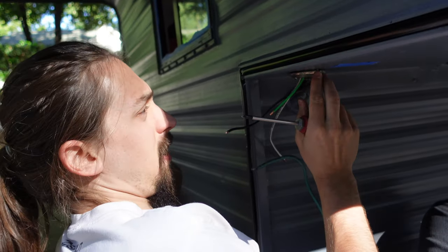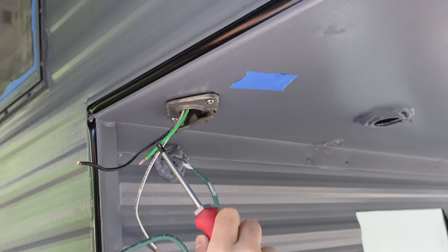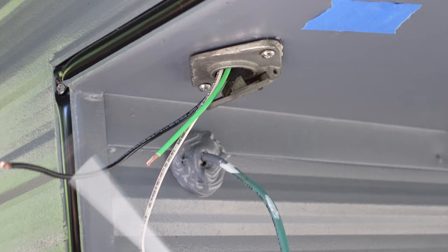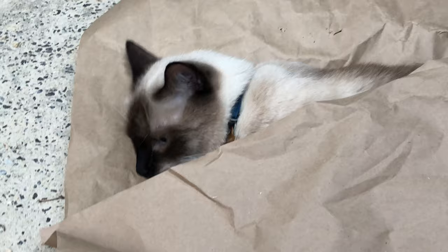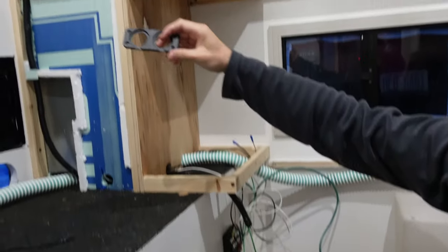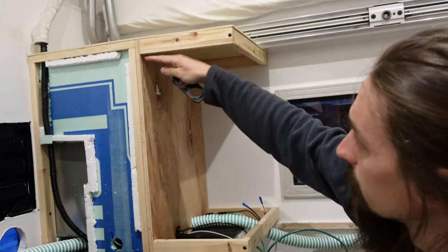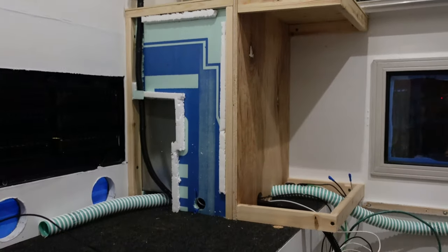I'm putting in the wiring from the car. This will bring in our wire for our running lights and it'll power one of our little 12-volt outlets when we're driving to charge the Jackery. These 12-volt outlets for charging our phones and other stuff are going to live up here, wired through this cabinet into this space, down and out to the fuse box.